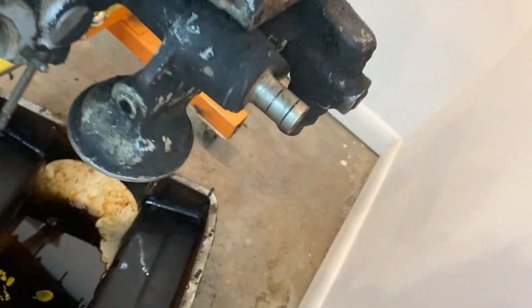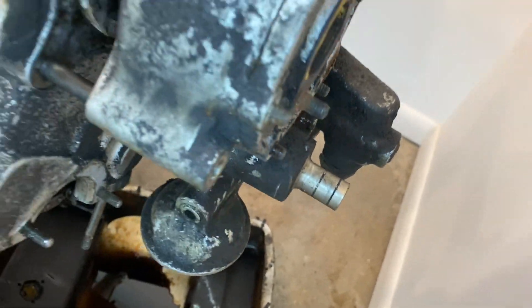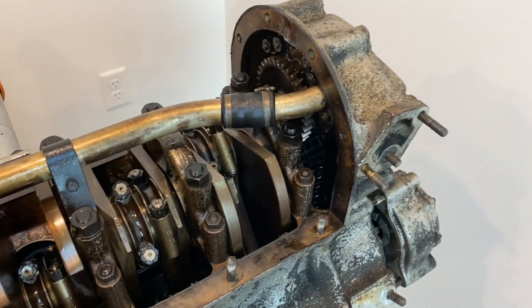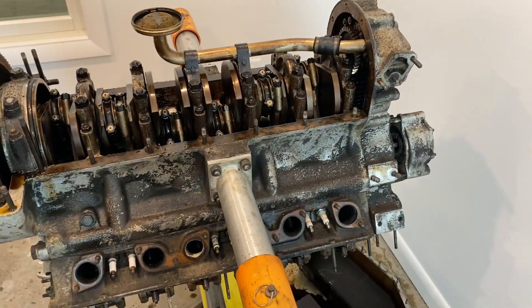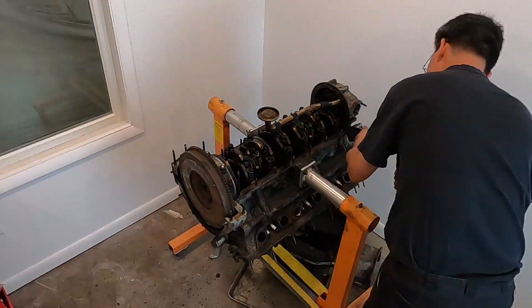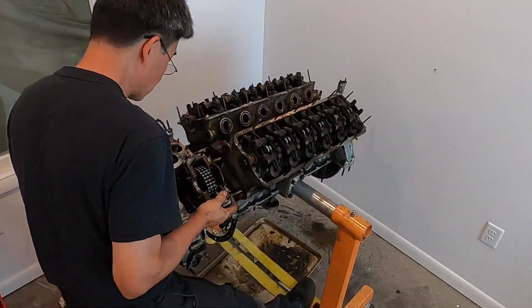I also have a problem here — I need a wrench to take that big nut off because there's a hidden securing nut that holds the oil filter assembly, and that blocks the water pump from coming out. So there are a couple little things that have to come off, but I can slide the whole timing chest off once I get this oil pickup soft hose disconnected and cut off. After cutting the safety wire off and removing the hose clamp to that soft hose, I carefully started working the timing chest off. Even with all the bolts off, I had to be careful that nothing cracked or was forced, but eventually it came off.